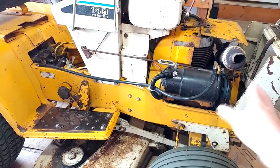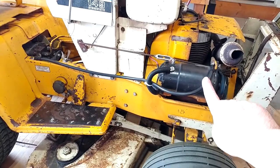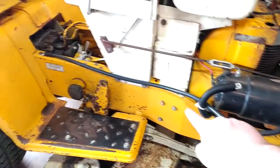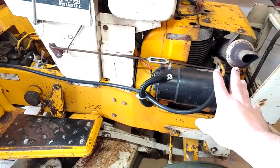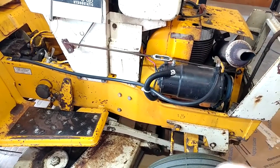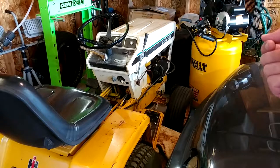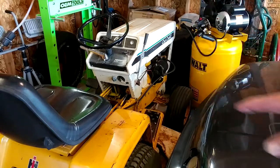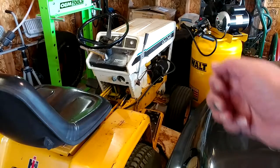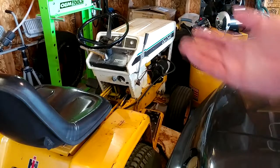It occurred to me that maybe we just have an engine grounding problem. So for testing — temporarily — I've just ghettoed up a wire to this bolt which goes straight into the starter generator and then back to an existing chassis bolt. This is not an ideal ground, but it already has some amount of ground anyway. If after a couple weeks it looks like this is helping, then I need to figure out what's going on with the motor — maybe the thing is missing half its bolts. I just took it out and mowed with it, started it up a couple times to see how it behaved, and I think that is an improvement. Might have something going on with the ground circuit. I won't really know until basically winter when the temperature gets really cold and the oil thickens up — then we'll see if it cranks like it should or like a bag of crap. My temporary fix is going to probably be with us for the summer.